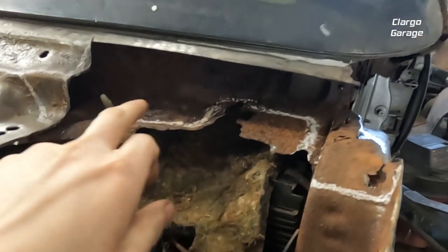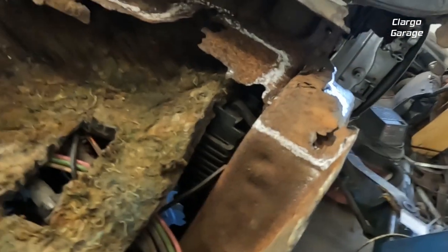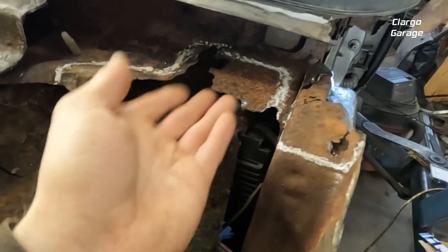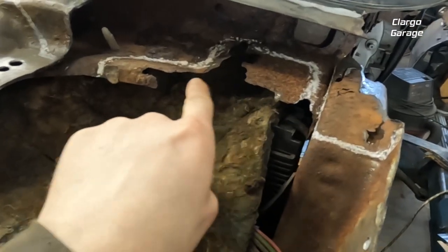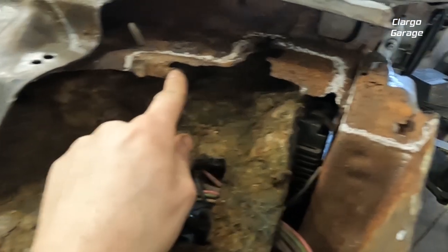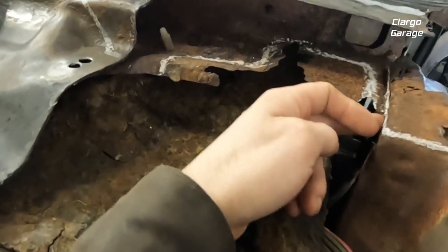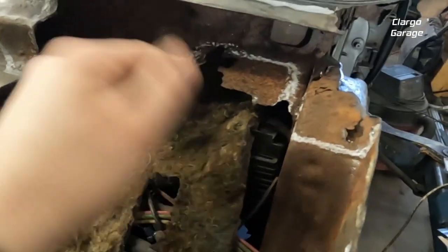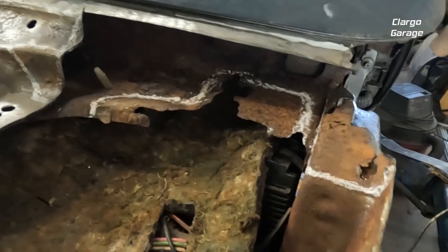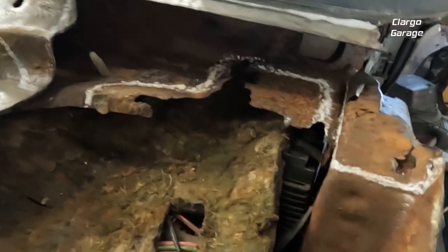I have a little more cutting to do — I'm going to cut all this stuff out here and up in here because it's not looking the greatest. I wanted to show it first to show how sometimes when you're looking at a piece there's obviously quite a bit missing. I think a front part all the way along here is rotted out and missing. There's this nice turn-down edge here, so taking a guess I'd say that edge is going to follow roughly on this angle to here, and the top part should come and meet that edge, maybe with a slight kick up.